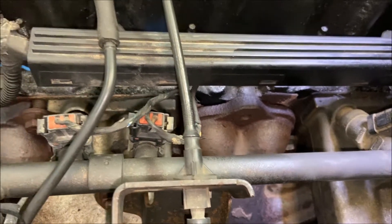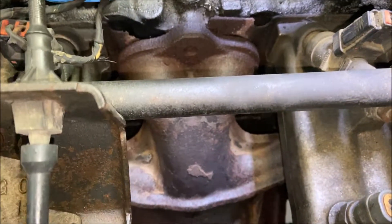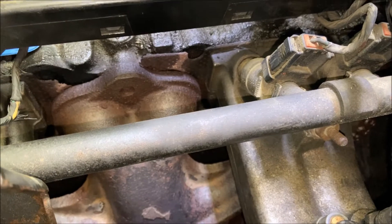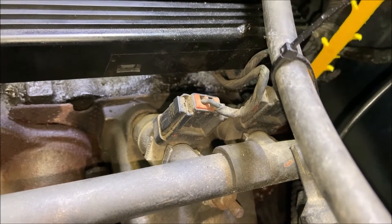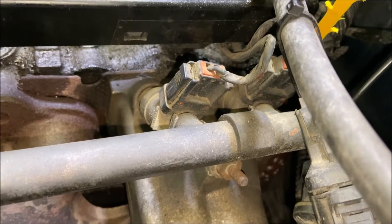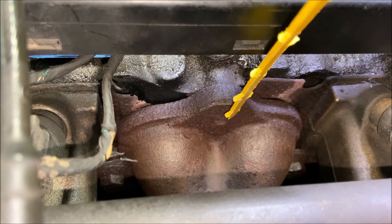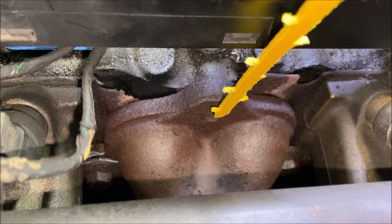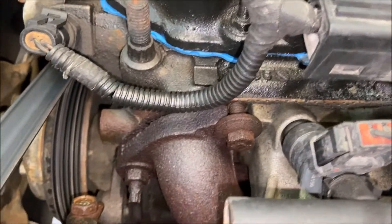Step zero is to do some recon and also get out your PB Blaster. For the last five or so days I've been hitting everything I can with PB Blaster. There are two bolts — one in the back and a nut at the bottom on the exhaust manifold — make sure you hit both of those. There's also a missing bolt; I stuck a straw in the hole and it goes back pretty far so I don't think it's snapped off inside, it's just missing. You can also see there's a lot of gasket missing up at the top, so obviously there's a leak going on.